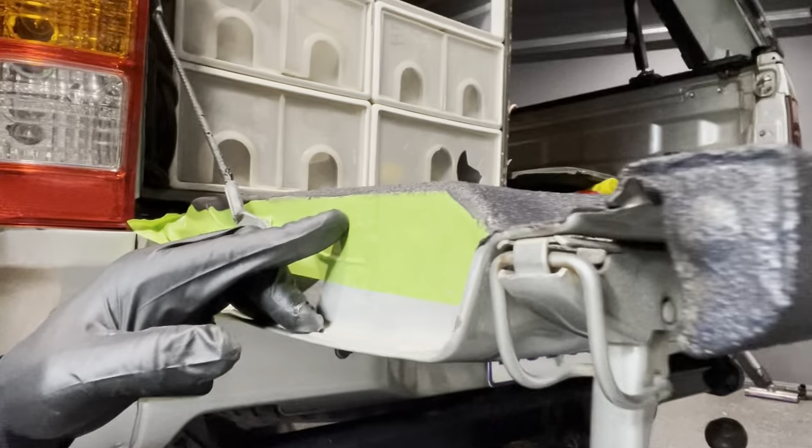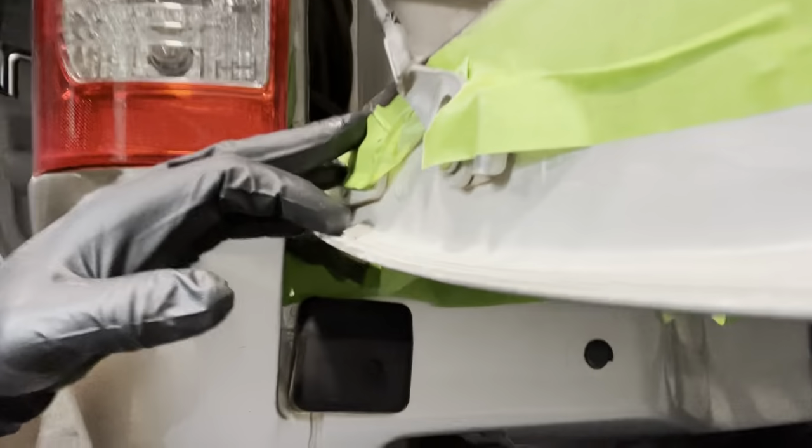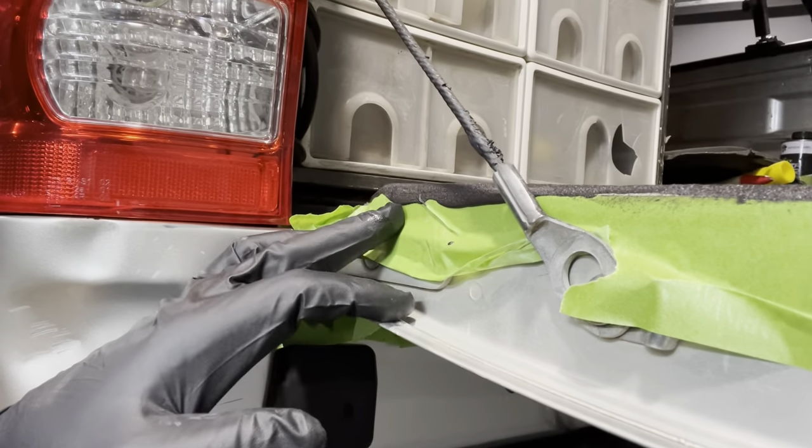And then I'll be able to cut the tape away. I'll probably cut the tape away because on things like this, especially edges like this where you've painted over, if you're not careful with rubberized or flexible paints, you'll end up actually peeling the paint up if it hasn't adhered, or in this case, the coating. You can see it's quite thick over here, so best off to cut that and trim that away. But it's pretty cool kind of rubberized cement. It's a good little test area on this back, and it was so scratched up.